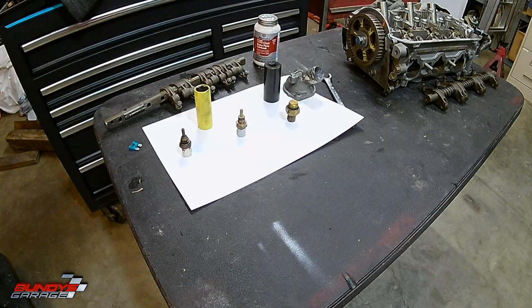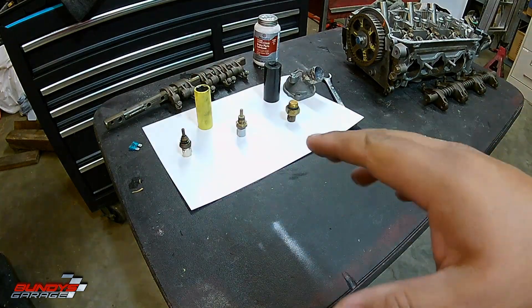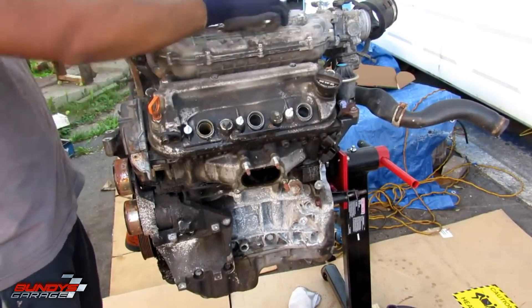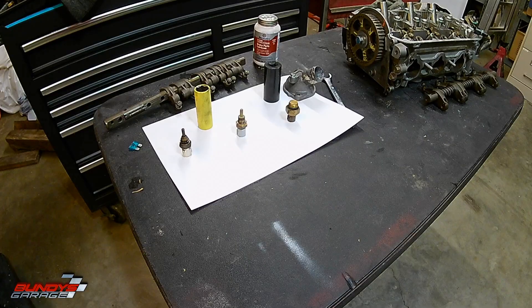The heat soak problem is: you'll drive your vehicle to a store for 15 or 20 minutes, you come out and start it, and the vehicle shudders and shakes and wants to die. To combat that, I gave it gas, revved the engine a little bit and got it going. You might have to sit there a minute, let it rev up so it doesn't die.